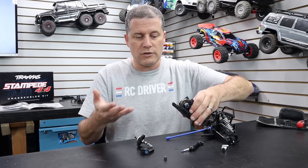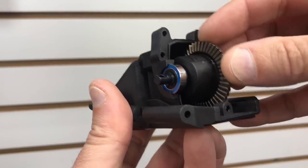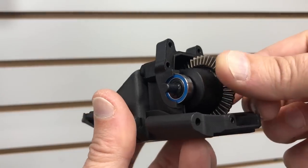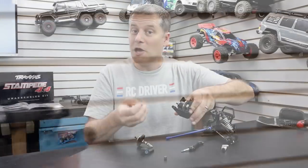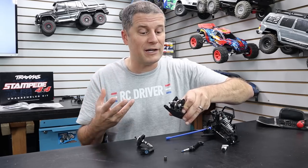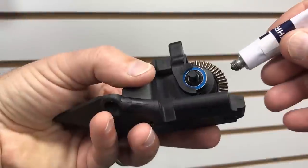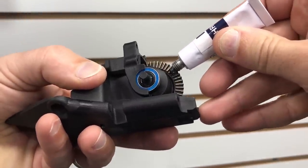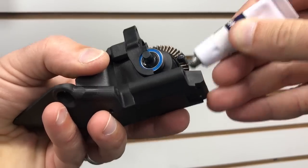Now, with this particular setup, we've seen the differential in part one, but there's actually another gear in this gearbox here called the bevel pinion. And you just want to familiarize yourself with it. Obviously it's got teeth on there. You want all the teeth to be there, otherwise it's going to cause a grinding noise. So if you hear that grinding noise, it may be because a tooth is broken off, or if the driveline has a whine to it, maybe it just needs some maintenance. Maybe you need to add some more grease back onto the gears to make everything work nice and free.